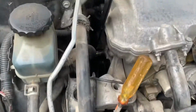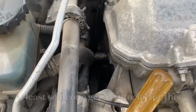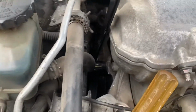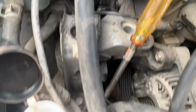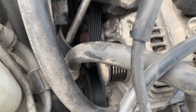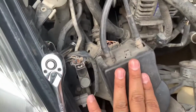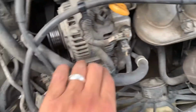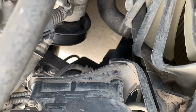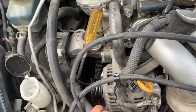But basically, yeah, you take it off with the 19 millimeter 6-point. You will strip it if you use anything else, because those things are made of aluminum, which is pretty fragile. And yeah, disconnected the belt, and then I'm gonna figure out all this stuff right here. I'm probably gonna remove this just to have more space, put it to the side. I don't think I'm gonna move that at all. I don't think I even can. Yeah, there's a 10 millimeter bolt. So that is basically it.